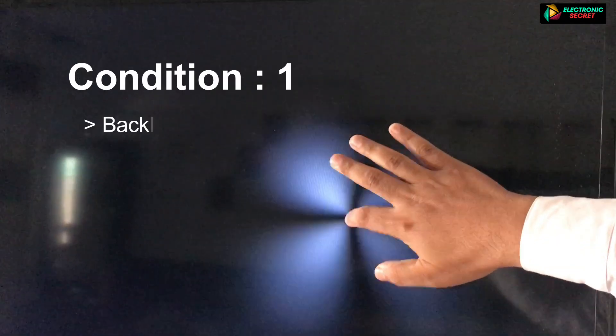Power on your TV from the remote and see the display. If you can't see the display, then gently hit the TV screen with your finger. Remember, don't put extra force as that would result in panel breakage. Do the same as I am doing in the video. If you see the screen blinking or flashing when you hit it, then it means that your back lights are working but your panel is faulty. This is the first condition, and we will fix this in a later part of the video.